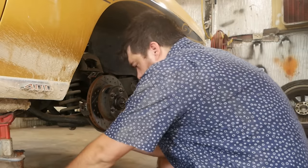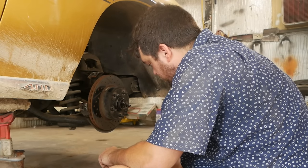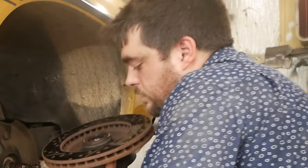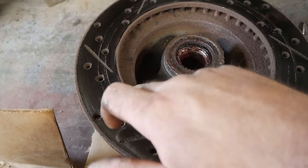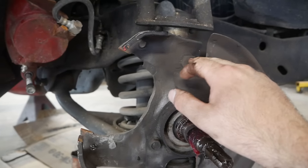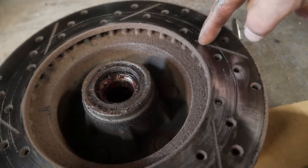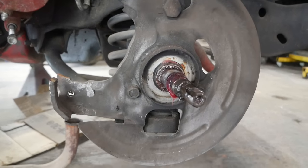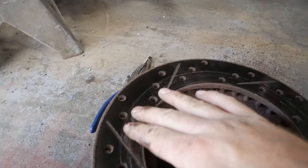This car was originally a drum brake car, and when I was 18 on my way to work at the plant I spotted a '72 Le Mans sitting in an upholstery shop's parking lot being parted out — sure enough it was a disc brake car, so this is all GM stuff in here. I bought new rotors for this thing. See this groove cut in here? It's actually really bad. What happened was my girlfriend and I were on our way back from the drive-in when I was about 19 or 20, and the spindle bolt backed out and it just dragged and cut right through there. We were flying down some back highways and it started making a horrible noise. Back then I didn't have the money to put a rotor on it, but at least I can swing it now.